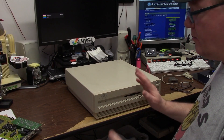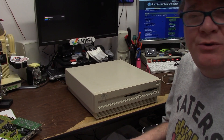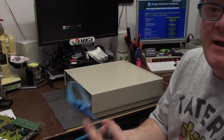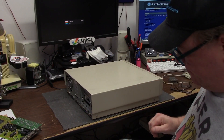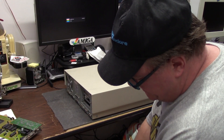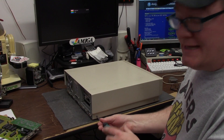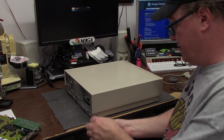We're just going to pop the top — we don't have to take the whole unit apart this time. I've added my rubber mat. Ankle bracelet is always right here. Please make sure you give yourself enough room so it doesn't spring load and shoot you in the foot. That will ground us out against any electrostatic discharge.